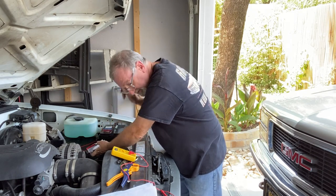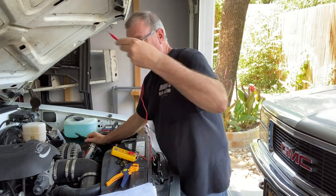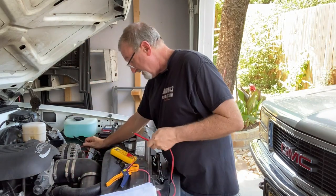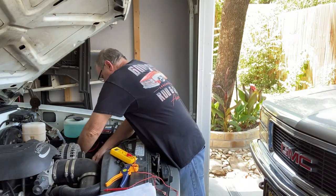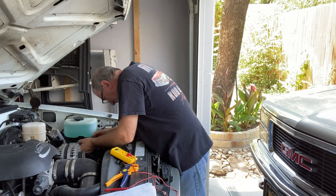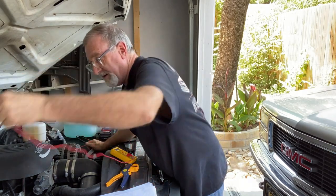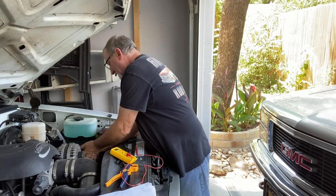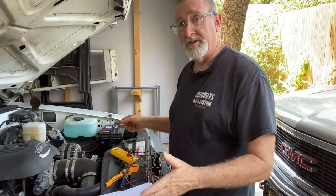There's a prong right here. Let's see which wire it corresponds with over here on the fan relays. Okay, so we got that correctly — that's fan control number two. Now our low speed fan is blue number 42. I've already taken the cover off of it so it'd be easier to find. And 42 is this blue wire right here, and that should correspond to this one, which it does. So we know we got the low speed and the number two fan correctly wired as far as the connection and the trigger from the PCM.